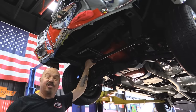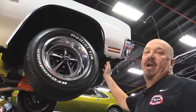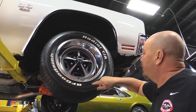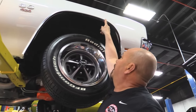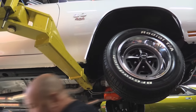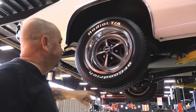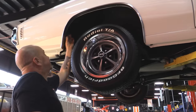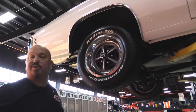Go to any car show, slip mirrors underneath this — I guarantee you're going to win an award. Let's take a look at wheels and tires. We've got SS396 wheels. Trim rings look great, center caps look great, paint work on the wheel looks good. 235-60-15s up front. That wheel well is nice and clean. That lip molding looks brand new. Bottom side of the fender — looks like they polished that bottom edge. Check out the rear wheels — trim rings are beautiful, center cap's beautiful. And we've got 235-60-15s back here. Wheel lip looks good — always check this lip here. All I feel there is two pieces of steel — that's the quarter panel and where the inner fender come together and are spot welded together.